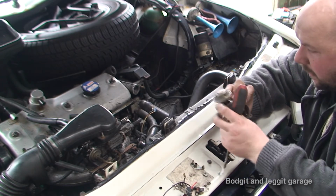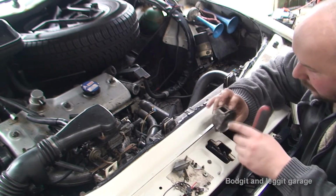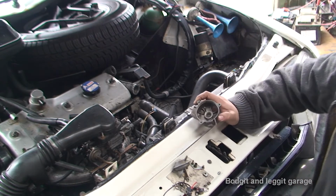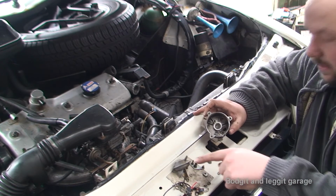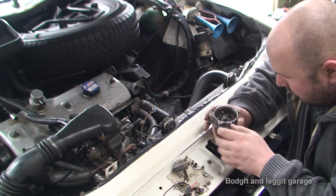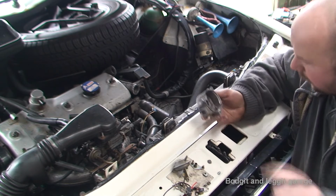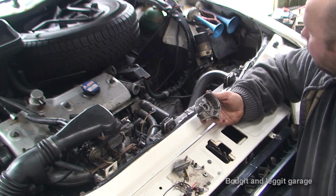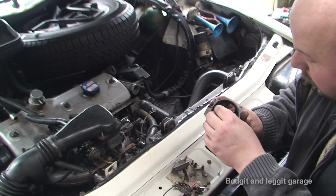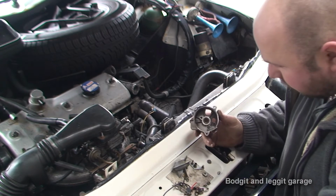And we've got the spring left there. We don't need that because that's just going to get in my way, so I'm going to make a little plate here just to blank that, because we don't need the vacuum on this anymore because we're not using the same setup. And hopefully I can knock out this pin, because I think the pin's going to get in our way. So we can knock out the pin. So as you can see, the little pin's come out. It was just on some spline, so I've literally just punched it down.